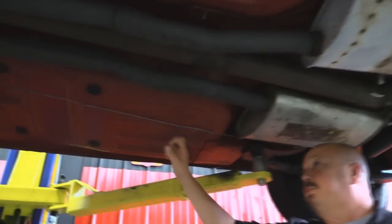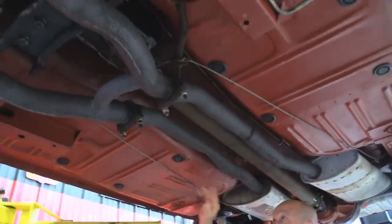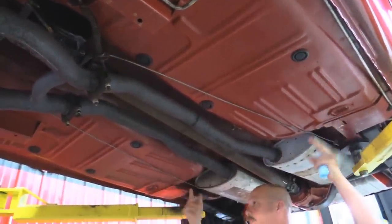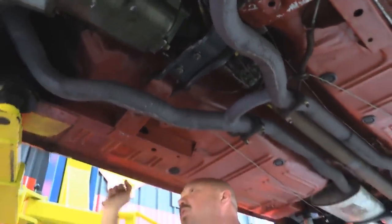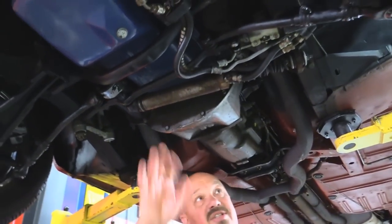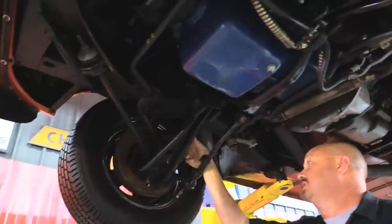You can see the floorboards have been painted red — it's not really red oxide, it looks like paint. There's a little bit of undercoating here and there. We've got bare metal showing on the frame. The frame where it comes into the floor pans looks great. We've got awesome pinch welds. The torque boxes are absolutely beautiful. We do have a numbers matching top loader in her. She does have power steering and all the steering gear looks good. Ball joints look great — it has had some replacement ball joints put in the top.